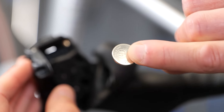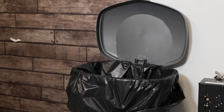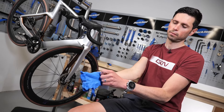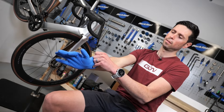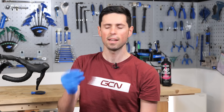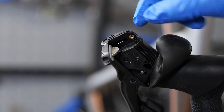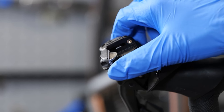Then we can just remove the battery, discard that, and get our new one out of the packet ready to refit — straight in the bin. As you remove the battery from its packaging, you're going to want some gloves. I was always told to wear gloves when handling coin cell batteries so that you don't run the risk of draining any of that power out. Whether or not that's true, I've got literally no idea, but why take the risk? Take the new battery and place it into the door of the lever body housing. Shimano recommend this rather than installing it straight back into the lever body.